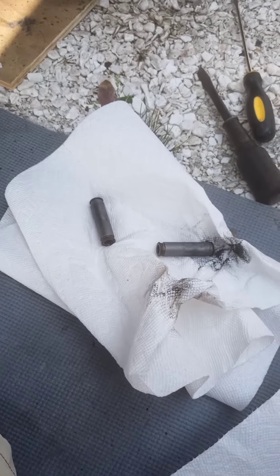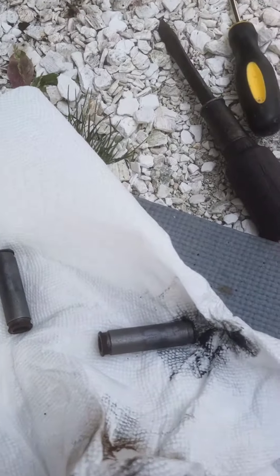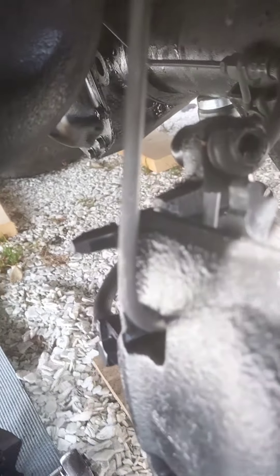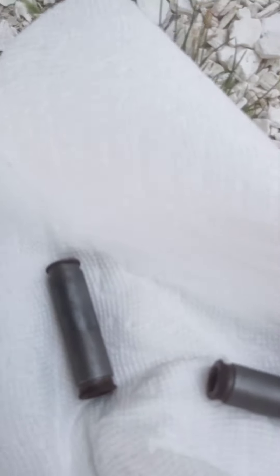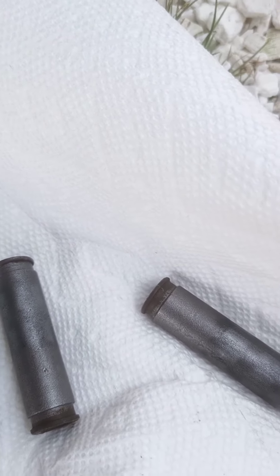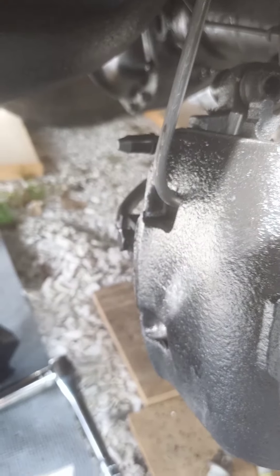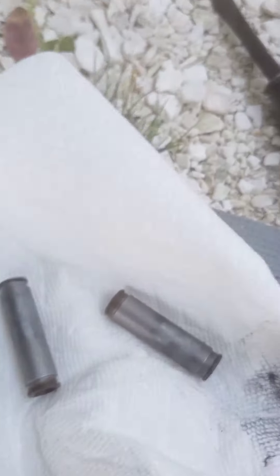On to the caliper cleanup — these little rods with the flanges are gonna be inside those rubber boots. You just push on that side until it pops out of its rubber collar and pull it out the other side. Be careful you don't rip the boot. You want to clean these up — if there's any corrosion you can hit them with a wire wheel. I'm going to clean this one because it's a little rusty, and keep as much lubricant as possible inside there. When you reinstall, use lubricant — I would use Ultra Synthetic like the Permatex stuff or Sil-Glide.